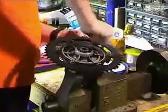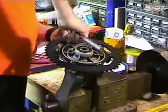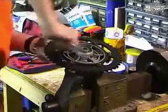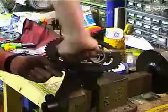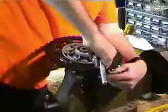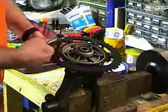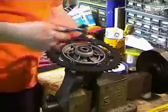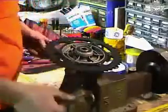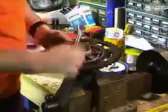Okay, with the washers and the nuts on, I'm going to tighten up all these bolts until they just stop. Don't want to really torque anything yet. So this way, the sprocket is sure to be centered on the carrier instead of being slightly off center. Okay, so with all the bolts in and snug, I'm going to torque them. You could look at the torque spec, or if you think you know what you're doing, you can just rely on your hands. So I did opposite ones, kind of like torquing lug nuts. I want to do them opposite.